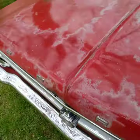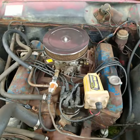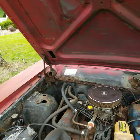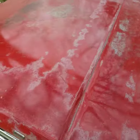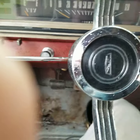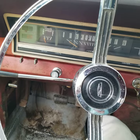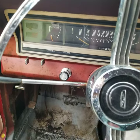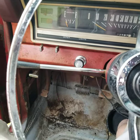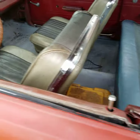Let's go look under the hood. There's your 390. The carburetor is shot — one of the emulsion tubes is split. I attempted to solder it and tap it back down into the carburetor, but I don't think I was successful. It seems extremely lean and it's running kind of rough. The dwell, timing, and points are all set perfect, so I know it's not that. It has new points, condenser, cap, rotor, and plug wires. I'll start her up for you guys — starts and revs great, but try to hold RPM and it gets rough. I think it's because of the uneven fuel mixture in the carburetor. Also, the radiator leaks, and we're running a boat gas tank. The boat gas tank is not included with the sale of the car, but it can be used up to the point of the car being loaded however it's going to be hauled after the sale.